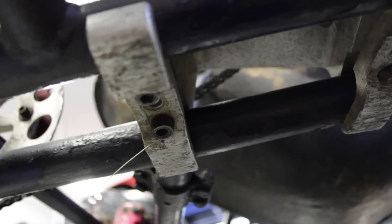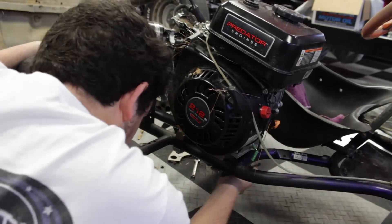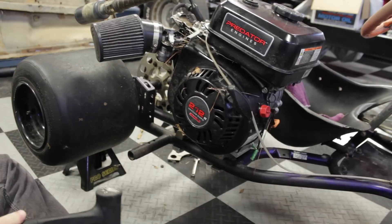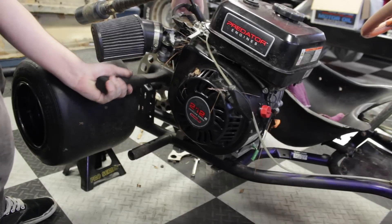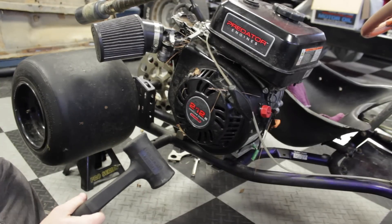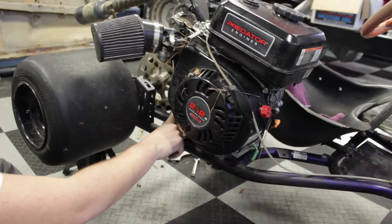Underneath the engine you're gonna see four hex bolts — well, I only have three, but it'll be fine. Once you've loosened them, get a rubber mallet, or you could even use your hand, and just tap on the engine mount pushing it forwards. Tap lightly because you don't want to break anything — use a rubber mallet or be very very light with a hammer because this is aluminum and it could break. This engine is from China and it could also break pretty easily.